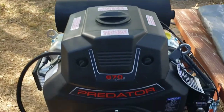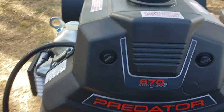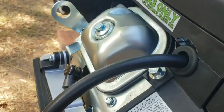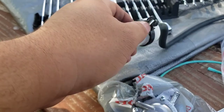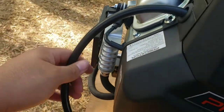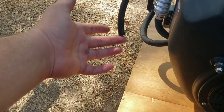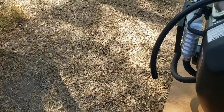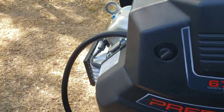Just like that, we're all put back together. I'd say like new, but it's a little more improved than new. So we got a little grommet. I took off this piece; it wasn't sticking on anymore, so just leave it with the old filter. Got a quarter inch line, got some of it out. Connect the fuel filter here, a little more line, a shut off valve, a little more line, and into a 6 gallon fuel tank that Russ sent you.